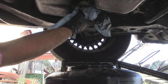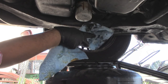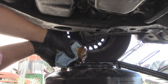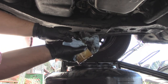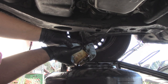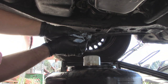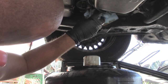There shouldn't be too much more that's going to come out once I pull it out, except for what's already in the filter. Dump all that crap into the oil pan. Verifying that the gasket's still on the filter — there. So I'm going to throw that in, let it sit, let it drain, and clean up the mounting surface just a hair.